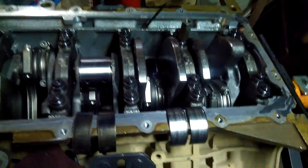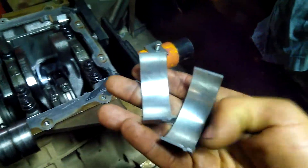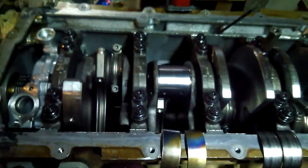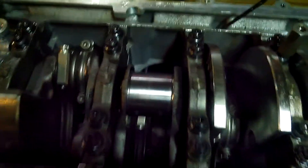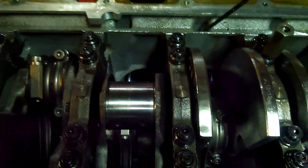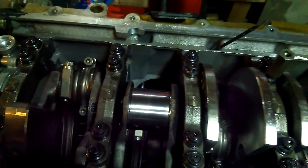We're going to try sleeving in another one. Just got to go buy another set of Clevite bearings and go from there. I do have new unused bearings out of a factory connecting rod, as I still have some spares, but don't really want to mix and match a bearing set right now. So, this is what the inside of a Coyote V8 looks like, and that's why mine was damaged. If you're getting a sporadic knocking issue, it might be time to stop driving it and take it apart, because things will only get worse.